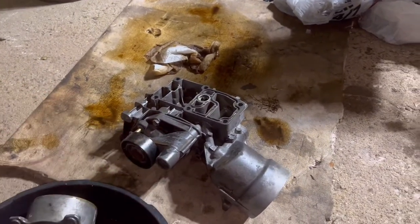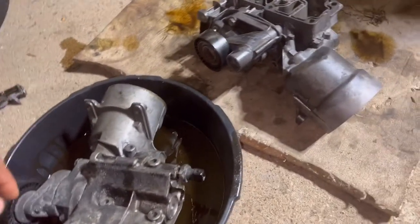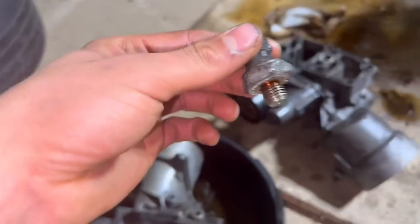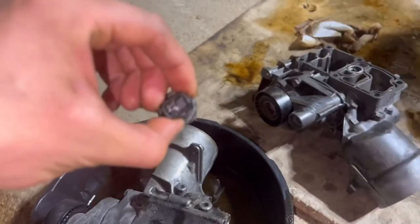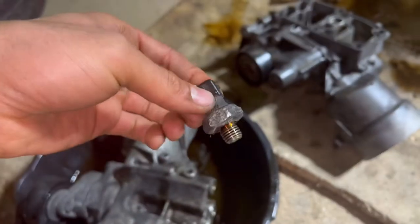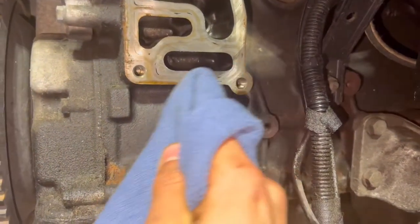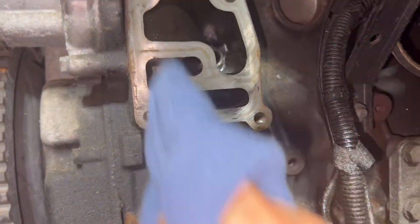Now that the new — or I should say pre-owned — oil filter housing is pretty much all cleaned up, I've got to take this little sensor right here. Since I'm being kind of cheap and lazy, I'm just going to take the oil sensor from the old housing, clean it up real quick, and slide it back onto this pre-owned one. It still looks in really good condition, and this oil filter housing only has 91K miles on it, so I'll definitely get some more use out of this sensor. Now I'm just going to take a little cloth and clean the surface before I put the clean gasket on.